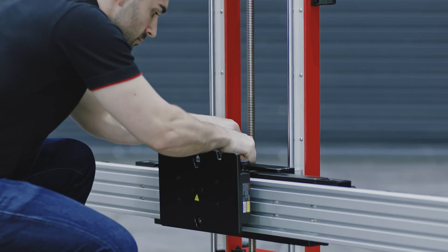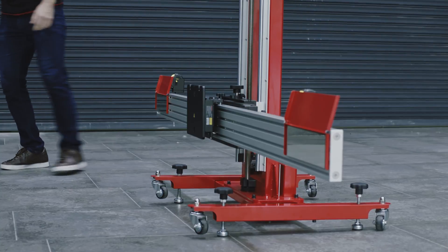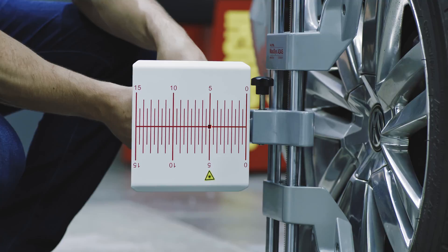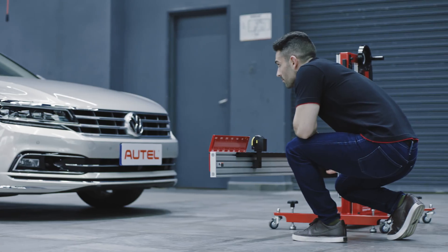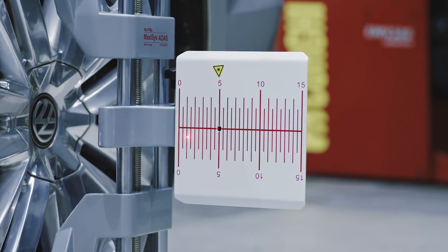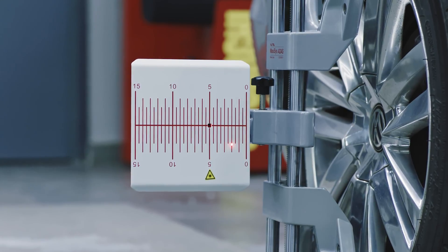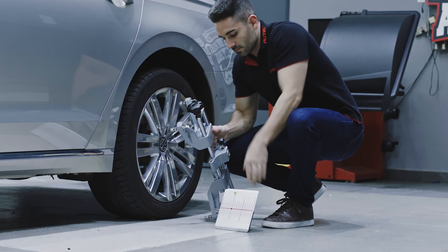Tighten the handle to secure the crossbar. Lift the cover plates on both ends of the crossbar. Adjust the lasers attached to the rear wheels to control the up and down movement of the reflected lasers. The reflected laser on at least one side must shine on the scale board of the laser coordinated board. Rotate the bolt left or right until the scale values lit by the reflected beams are the same on both sides of the bar. Now the calibration frame is parallel to the vehicle. Close the cover plates on both ends of the crossbar, then close the lasers on the wheel clamps and remove the wheel clamps.